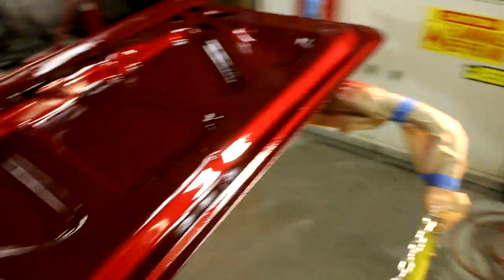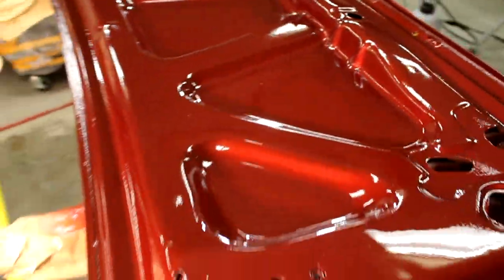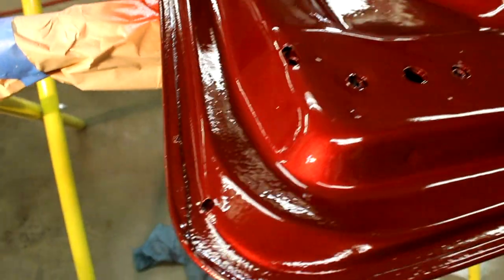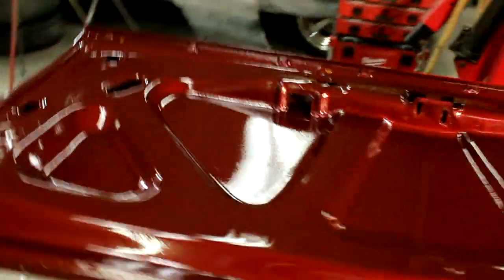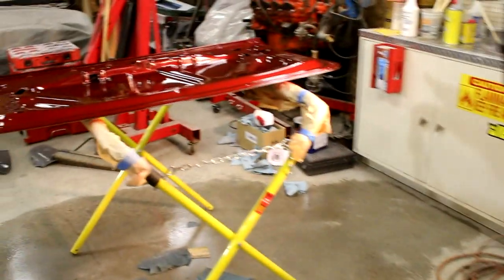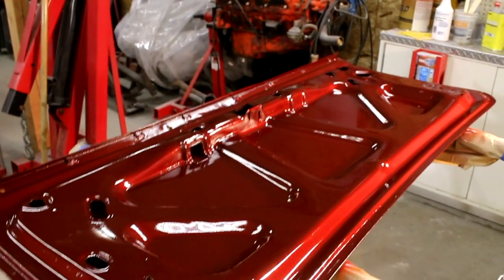Okay, so the second coat of clear is on. Some guys will just use a single stage for the underside of a trunk, but I'm just trying to practice because I've never done this before. Man, it shoots nice — this color looks awesome. I don't think it looks as good in the camera as it'll look when the sun's hitting it. It just has a ton of pearl in it, so it's never going to look as good until it gets on the exterior of the car. But this is a fun little project just to start jamming the car and get an idea of how the paint flows, how the guns need to be set up. There's a lot of tricks to it. I'll be doing a little bit of this as the days progress. Next big step will be the dash — that's all going to be painted. And then I'll jam the rest of the jams as well as the trunk jam and trunk hinges. A lot more body work to do to get that ready and lots of masking. I'll keep on keeping on. I just thought I'd do a little update on my experience here doing some painting for the first time. Hey, if you like this video, hit like and subscribe. Thanks.